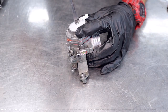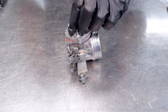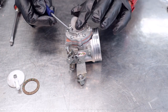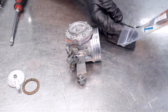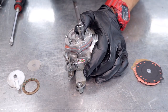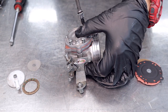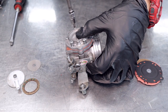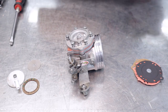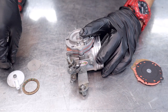First up we're going to remove the fuel inlet cover using a flat-blade screwdriver, then remove the cork gasket and the screen. Get your new carburetor kit out of its bag. With a T20 Torx bit on the smallest rattle gun with the lightest setting, we're going to remove all those screws. Be careful — they are small and it is only aluminium so you can damage them easily. Just remove the screws and lay them to one side.